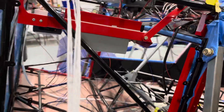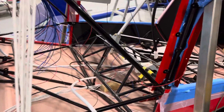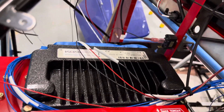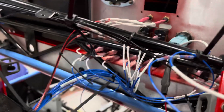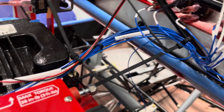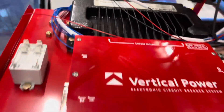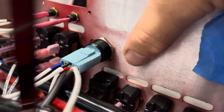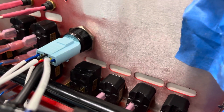Here's a Lexan firewall mockup — it makes it a lot easier when you can see what's behind it and where you can mount things. Chris mocked this up on his airframe with his 915, and I'm pretty much going to follow it. Here are signal wires coming in from the fuselage up to the vertical power and up to all the Garmin connectors — the engine ECU, start power relay, and the vertical power system. I've used blue for all the switch wires, which are all pretty much signal grounds, and they'll go up to the vertical power and to the engine lane light LEDs and start power.